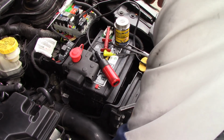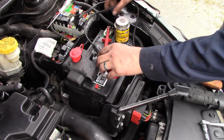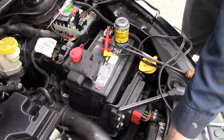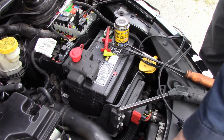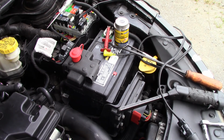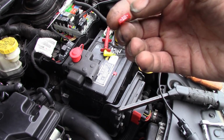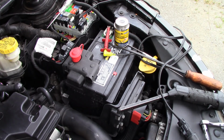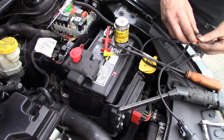All right. Everything looks all right now. I don't see any other gremlins here that are going to short us out. I'm going to go find the fuse, pop it in, and try it out. All right, guys, remember, if you're going to put a fuse in, make sure they look like this with the bright white numbers on them. Don't use those cheap see-through fuses. You'll pay more later when you find the smoke.